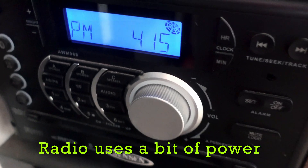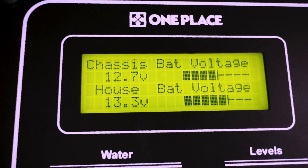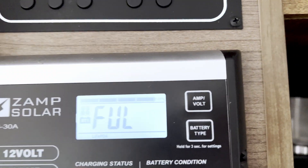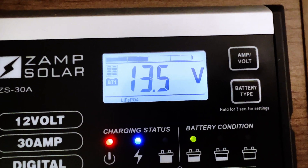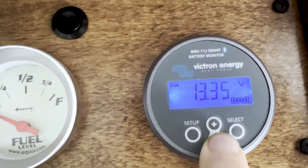After about a week of testing, I'm happy with the mod. I'm only losing about half an amp for all those phantom drains and the chassis battery is staying around 12.7 volts. When I actually charge from the engine, shore power, or generator, that charges the battery right up over 13 volts. For some reason my solar charger kind of shuts off around 13.5 volts, so I don't quite get a totally full charge, but it's close enough — I can live with that.